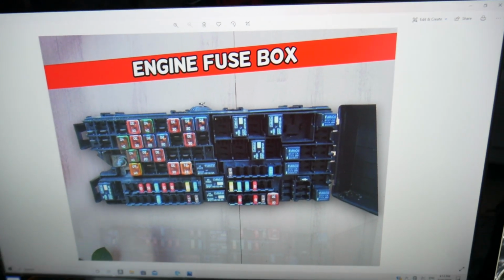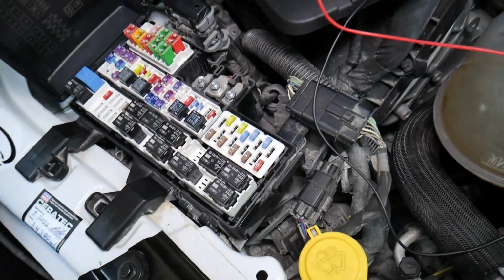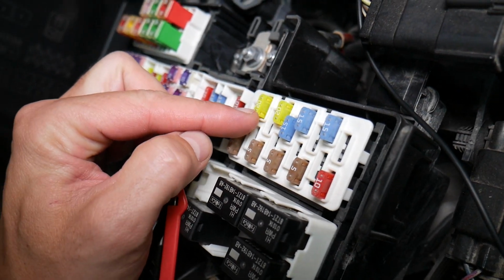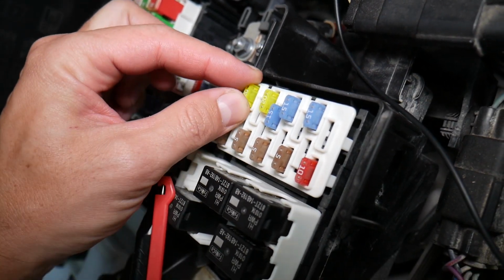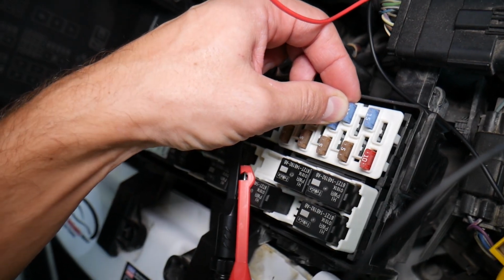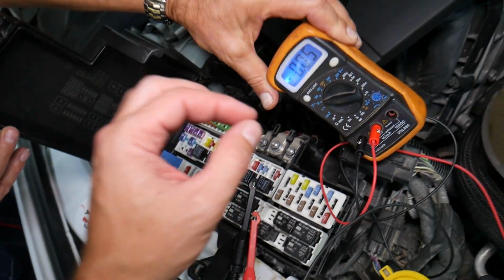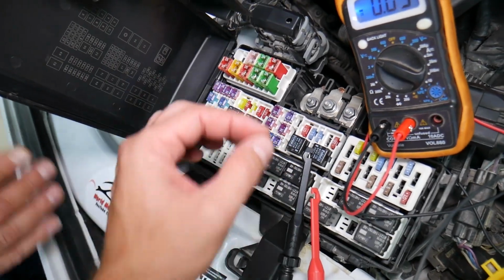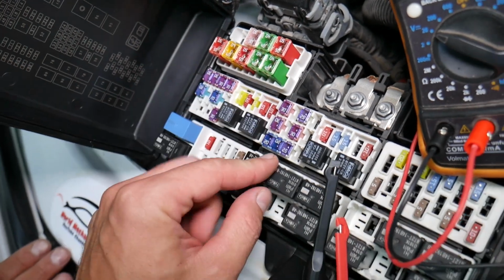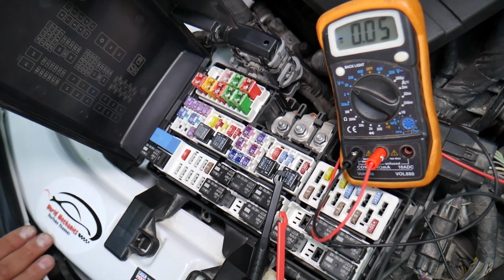Before we continue, let's explain quickly why it's always a good idea to test fuses and relays. It's super important to test fuses. Often you can't see if they're burnt or good. Sometimes they may seem perfectly fine, you think it's a good fuse, you put it back in, and you end up spending money and time on parts and problems that do not exist, when all you had to do was test your fuse, find out it's bad, replace it, and fix your problem. We will have a video on how to test different kinds of fuses and how to test relays. We're going to put the link in the description of the video below.